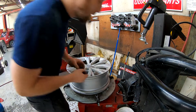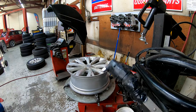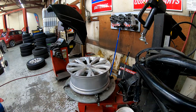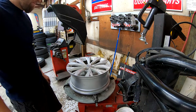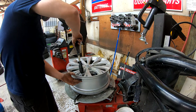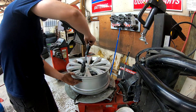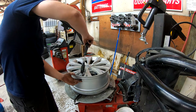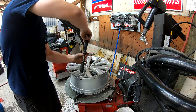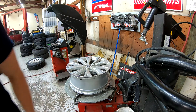Because the rubber will get old. We have our beautiful valve stem puller, which is heavily wrapped in duct tape to make sure it doesn't scratch up a rim. Stick it through, put it on, pull it right on, pull through, unscrew. Put the cap back on for a second.